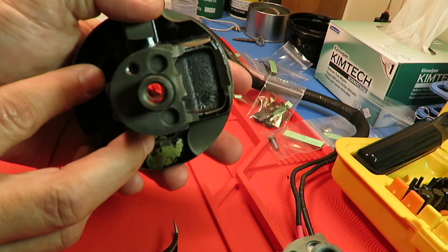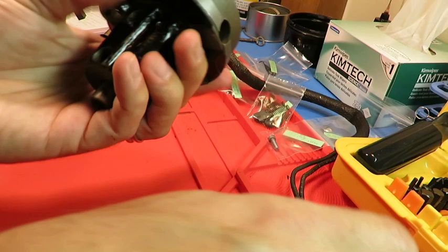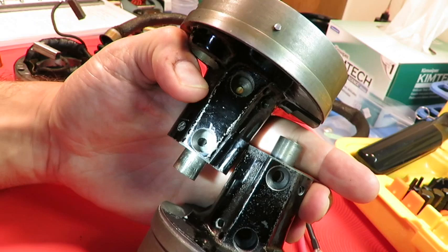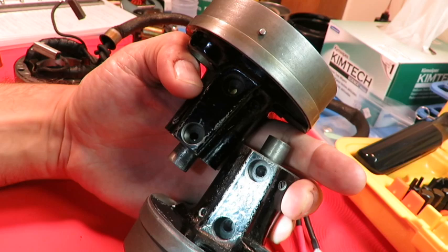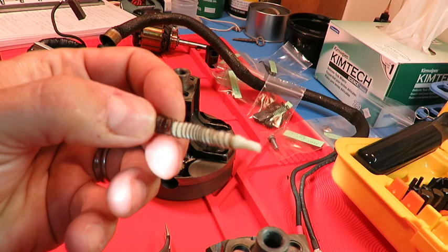And these holes that are drilled in the bottom to accommodate the cups in the housing, and then drilled actually all the way through the bushing, are kind of different sizes in these two housings. I'm going to get some extra light here so you can see. And so you can see that on the left side is the 1927 motor, on the right side is the 1930, that they're markedly different sizes. And the felt cording is pretty much a standard size. I forget what exact diameter it is. But I have some, and when I pulled the grease cups and felt cording that was old out of the 1930 motor, they came right out. And here they were really tweaked up in there, which is kind of not the point, because they're on a spring, and they're supposed to be able to sort of contact the bushing as it moves around, and there's freedom of movement there.